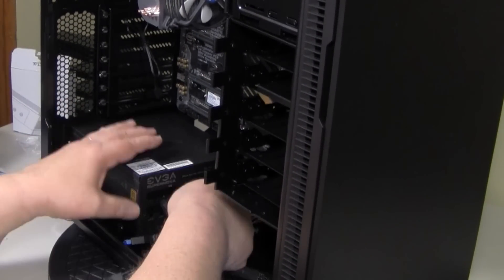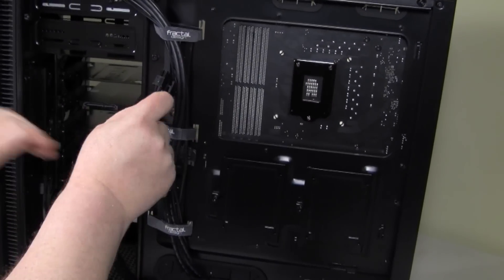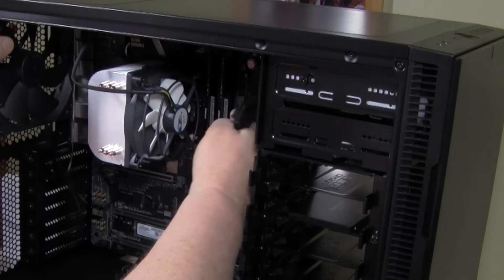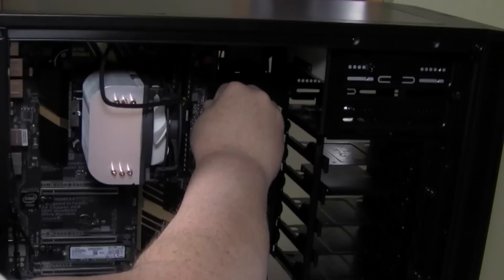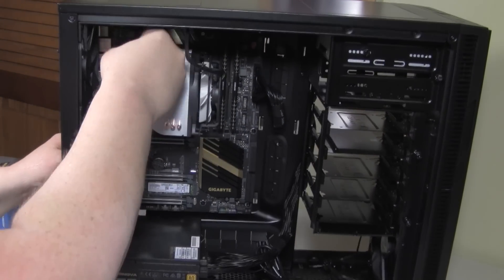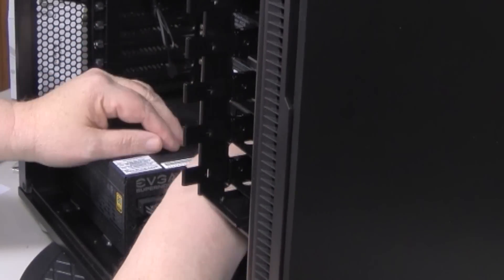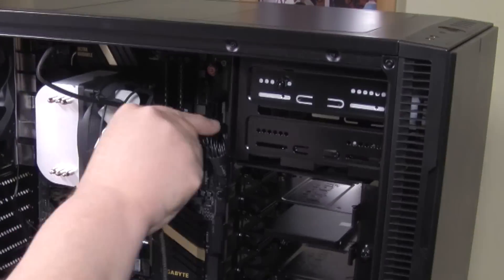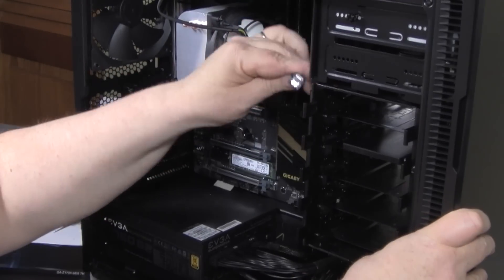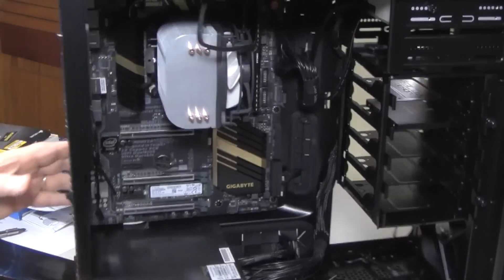This was one of the more challenging parts of the build. It was certainly easy to plug the motherboard cable into the power supply, but making sure it was the right way on the motherboard — it does have a clip on it — took some care. Doing it the first time, you want to make sure you do it right. The CPU power was a little different because it's a split connector of eight pins and you have to put it together to plug it in and get your hand back in there. It was kind of difficult, but I got it in. The SATA power was real simple — I just weaved it through and it worked out perfectly having the two drives right next to each other.